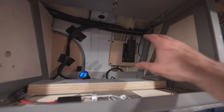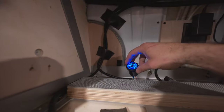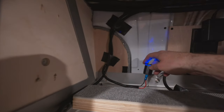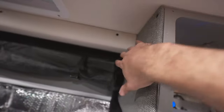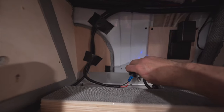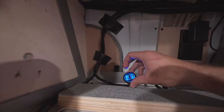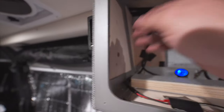When you remove the microwave, you get an extra outlet back here. We also hijacked this guy — this was running into the quite honestly trash Bluetooth speaker that they come with. I'm building a custom mount here and then I'll run just a USB off this. These are the exact cables Storyteller terminated. I just had to plug this in. Now I've got 2.1 amp USBs, which should power a Bluetooth speaker right through here.